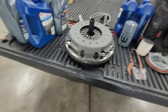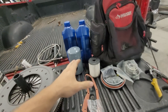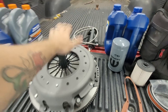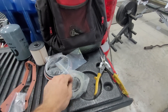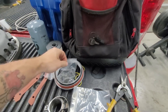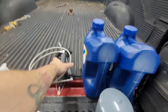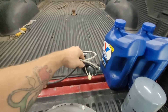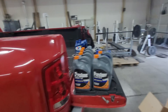First order of business: we got everything laid out — oil filter, fuel filters. I'm just gonna do those first and save the coolant for last. We'll get the oil change and fuel filter done, then start pulling the transmission today, which shouldn't be too big a deal. I'm not gonna get it all done today, but should have it done sometime this weekend, if not Monday. This is a Valair unit — I've never had a clutch job come back, and I really like Valair. Josh is running one. I don't like South Bend; that's just my preference. We also got new hydraulics — this is a self-contained unit, no bleeding required. You literally just install it and call it a day.